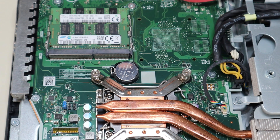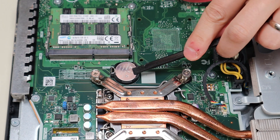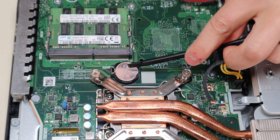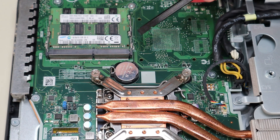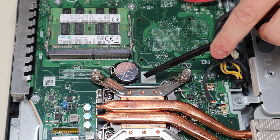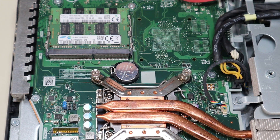The way to remove the battery is you put pressure a little bit down here, and then you push in there towards that spring to pop it up out of the cradle. Be very careful, because these cradles are fragile. If you put too much pressure on, you can snap one of these ends, and then you can't get that CMOS battery back there — it won't secure back down again.